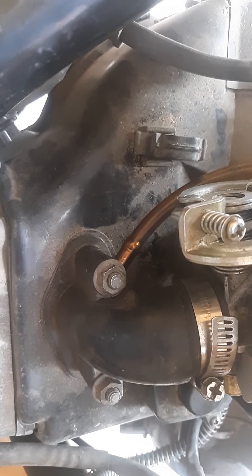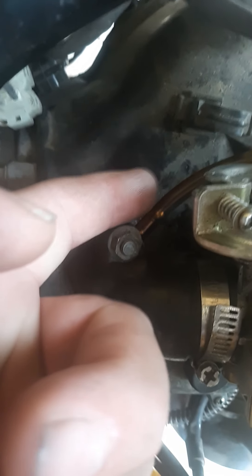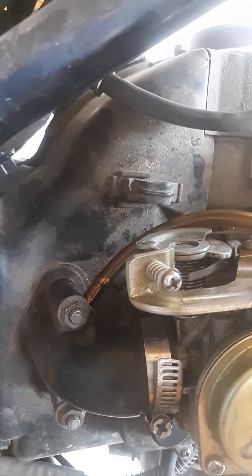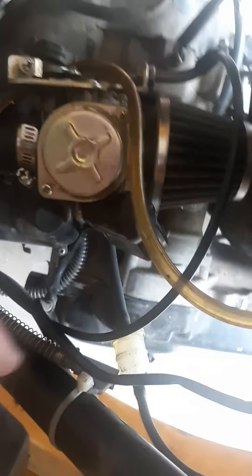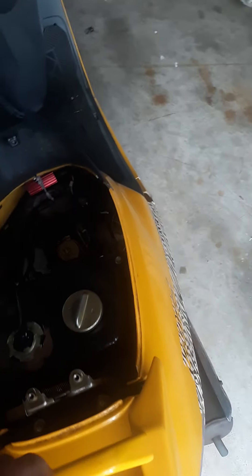What happens is, this forms a vacuum when you're cranking on it down here. It opens it up, lets the fuel flow down the other one into this. When I pulled this vacuum line off, what it was doing was sucking a little bit of air around that. And it was stopping me from giving it full gas, because when I'd give it full gas, this hose was stretched, and the vacuum would suck more air, which would not allow full fuel flow through the line.